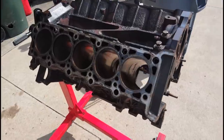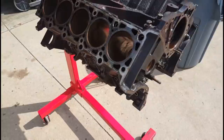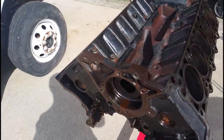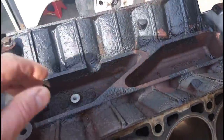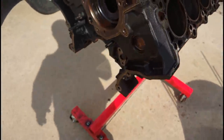As you can see, we've got the engine stripped down to just the block. All the pistons are taken out, which we're going to have to replace with new pistons, and we're going to have to bore and hone the cylinders. There's quite a bit of rust in here — rust on the top, paint, scale — it's pretty nasty and dirty.